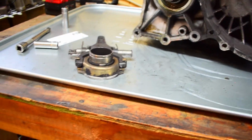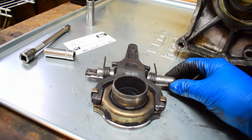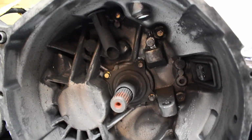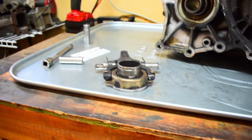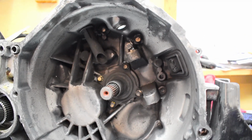It'll come straight through. You've got to remove the plug because you've got this rod here that slides through the clutch fork. It mounts up into here, and that hole, right here, gives you your access point to push the rod out and through to get it out of the transmission, because without pulling this out of the way, you're not going to be able to get that clutch fork out of it. So it's not really too hard to do.